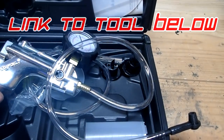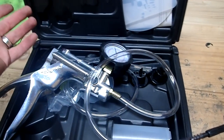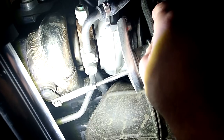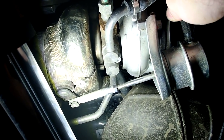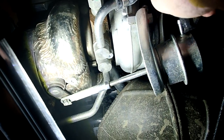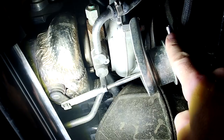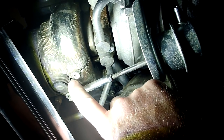For the 2018 tune, BRP says when you tighten the actuator two and a half turns it should equal 7 pounds — and 7 pounds is what we want for 2018. This is the wastegate, this is the wastegate actuator, and this is the vacuum line. The first thing you'll want to do is cut the clip off — there is a new clip that comes with the kit. Then we'll hook the Mighty Vac up to it, putting pressure out rather than creating a vacuum, watching for the wastegate actuator to move — the first sign of movement should be at roughly 6 pounds.